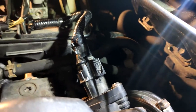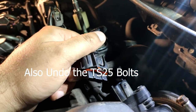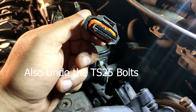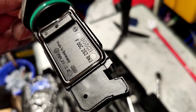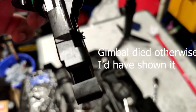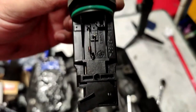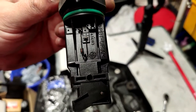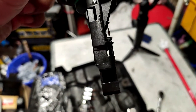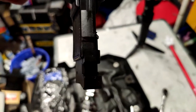So the first thing to do is press down here and then pull that out — that'll disconnect your MAF connector. Make sure you plug this back in when you've cleaned it, because if not the car will run funny and give you error codes — I've done that once. So we've got the MAF out; it's a Bosch MAF. In this hole here — I think that's where the air enters — we want to spray the MAF cleaner in there, and on the backside as well on the wire. Make sure you give it a good liberal spray, and make sure you let it dry before you put it back in. Use proper MAF cleaner; don't use anything else, because these are a couple hundred quid if they break.